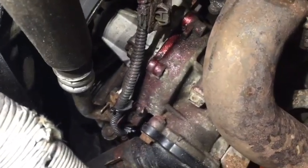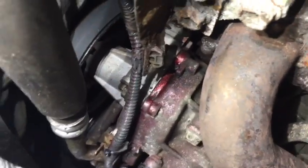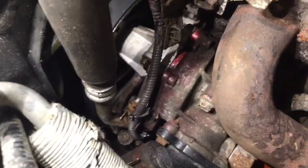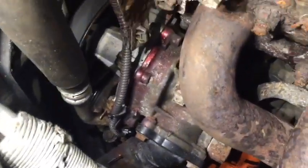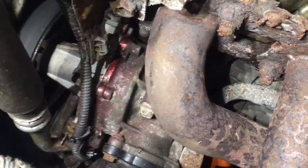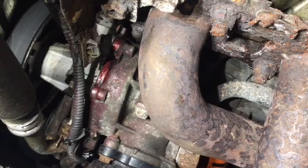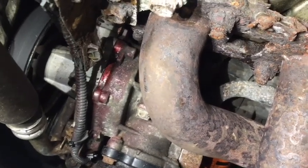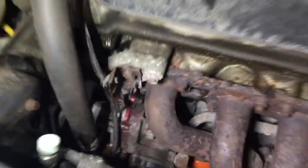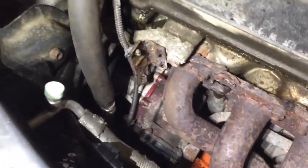Probably tomorrow once the system cools and draws from the reservoir, I'll make sure that's topped up again. No leaks — the red staining you see is from the tack gasket sealant, which was kind of useless. Thank goodness there's no green staining. So it is possible to change this water pump without removing the engine mount — that's not required. The key takeaway from this video: you must dismount the housing to get the indexing bushings clear and pull the pump flange from the housing outboard. Undo the four bolts from the housing — that's a must. Hope this is helpful to somebody. Cheers.